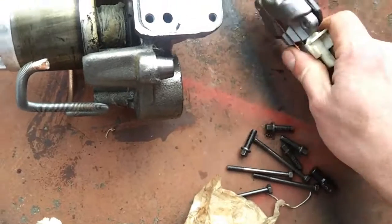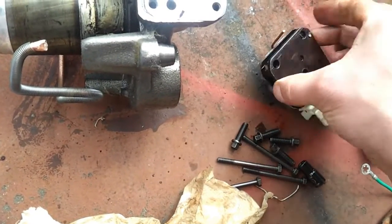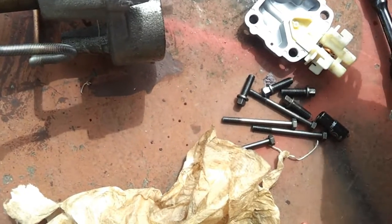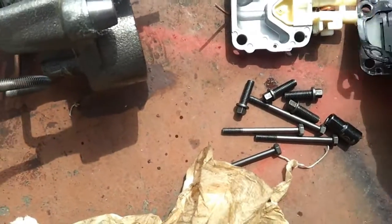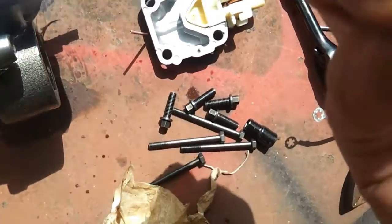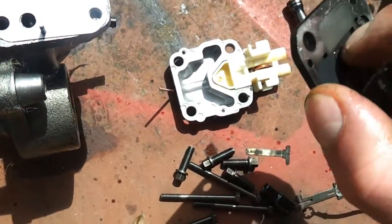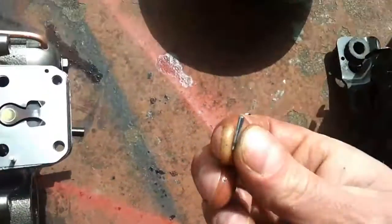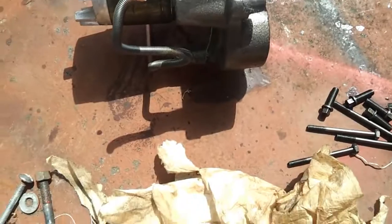See if we can get that apart. It's the reed valve assembly right here. Hard to do with one hand, but we'll manage. Something just popped out of there - I think it was a retaining pin. You can see the little oiling tube coming up in there. And these are the reed valves right here. That was the reed valve retainer, and this right here is the little flapper reed valve. That little retaining pin was part of the clip that holds the reed valve in place.